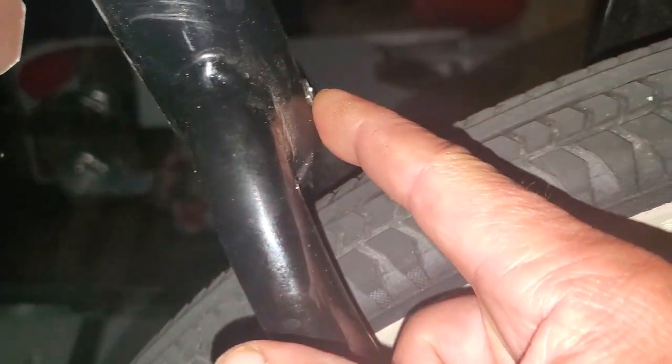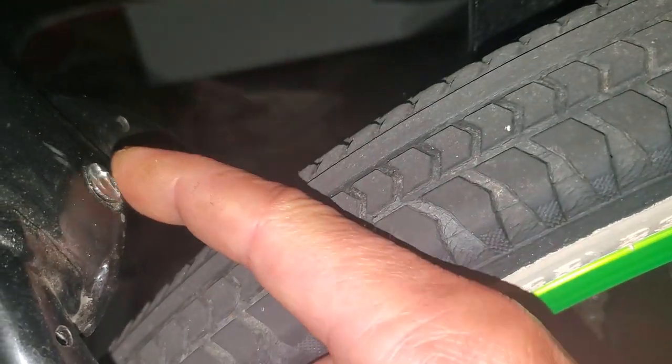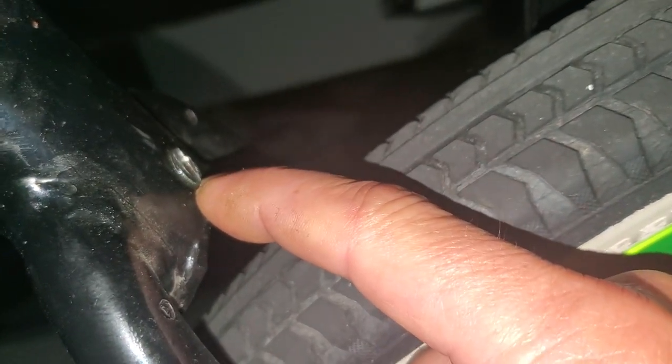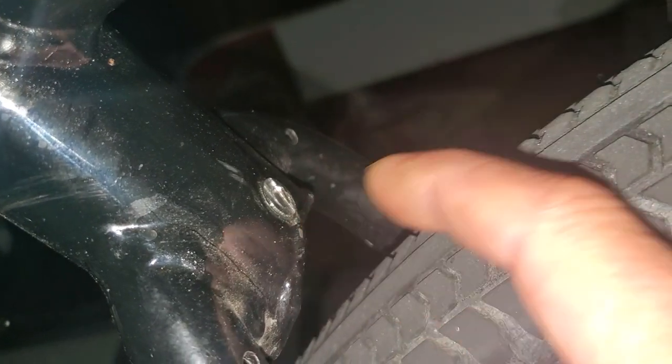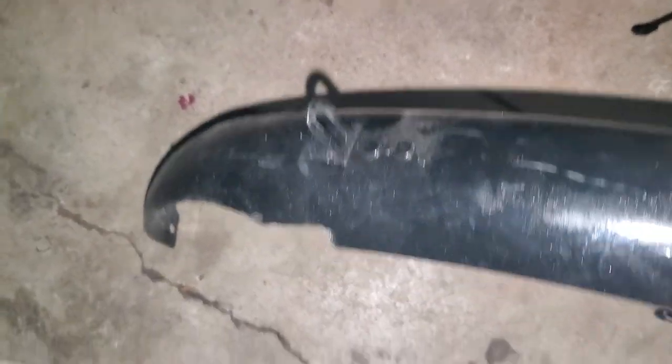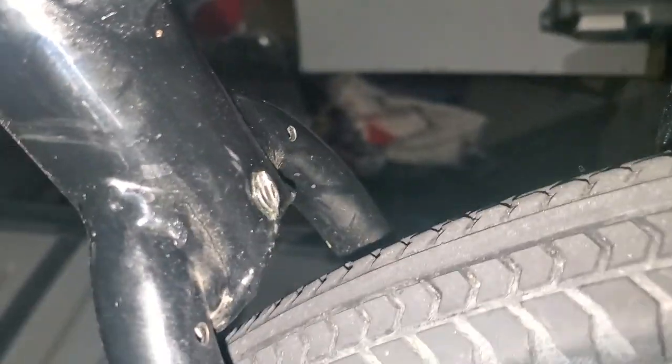On this one I wanted to leave the rear fender on, but there's a mounting bolt that's supposed to go right up in there. There was a hole there and this anchor nut is basically pressed into the frame — not even welded in. The bolt is supposed to go through there and hold on to the rear fender, but that just started spinning in there, which sucks, so it just wasn't going to work. It's left off — I mean, it looks pretty good. Just don't ride too much in the rain or you're going to get your ass wet.